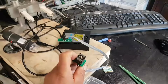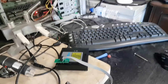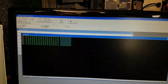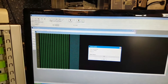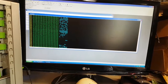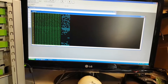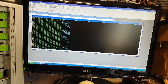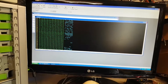I put the EPROM type here with the same orientation as the letters on the EPROM so I'll know which way to put it back. Chip in place. Let's open the software. I've already selected the chip - it's going to read. There is my data. Looking at this data - it's quite a small chip - I think I've seen the PIN already in there, but let's use a small software to retrieve the PIN and confirm if I got it right.